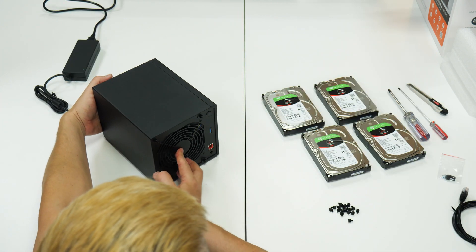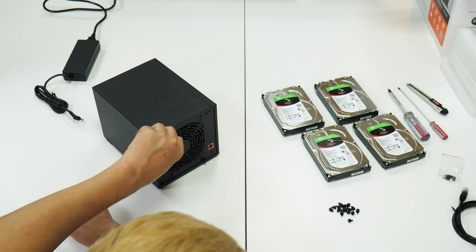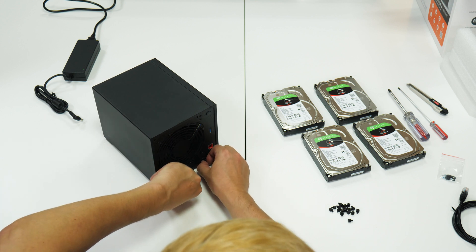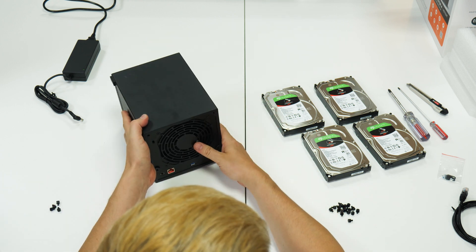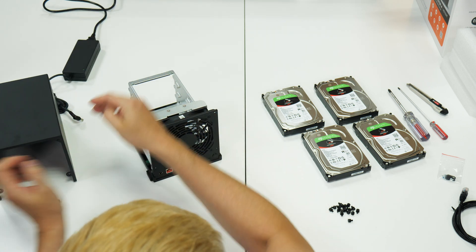This is my second take on opening the case — I had to grab a Phillips screwdriver to help as the screws were on fairly tight from the factory. Even though this is a tool-less design, usually first time out of the box you can expect to need a screwdriver, as that's how cases are assembled and is typical industry-wide. With the four rear screws off, we'll rotate the case so the ports are at the bottom and the cover slides back and comes off easily.